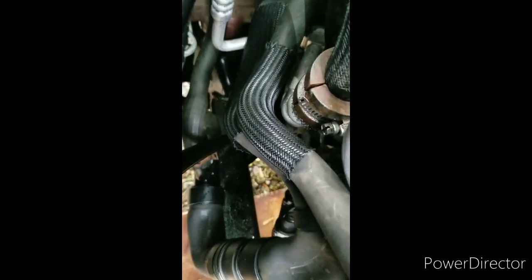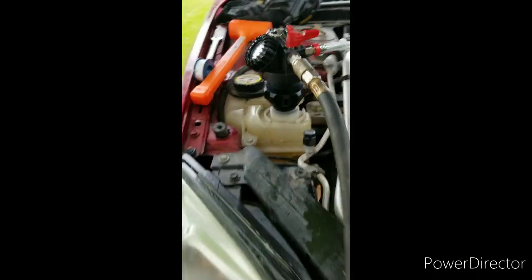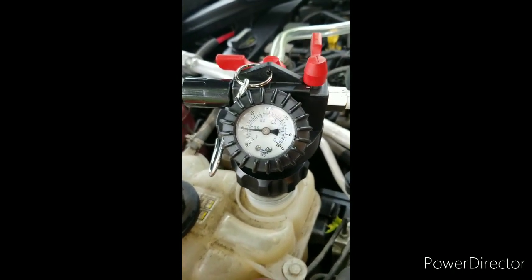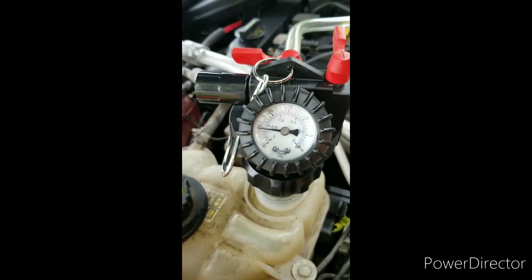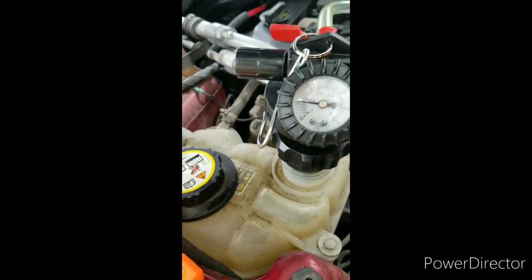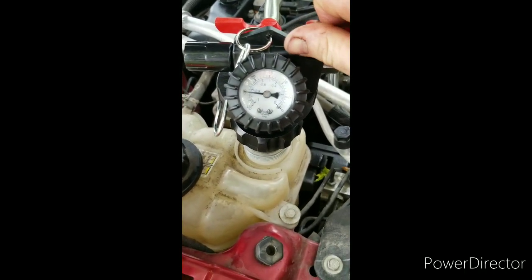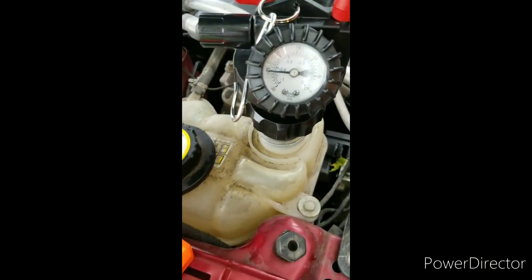The advantage is that now you look at that coolant hose — my main coolant hose right here, you can see it's collapsed, and that's the one leading directly into the radiator. So this thing's doing what it's supposed to be doing. It has pulled a vacuum on the system and it's staying at negative 25. We're going to make sure it's still pulling that vacuum. This one, which is the filler line, needs to be shut and turned all the way toward the front, and then you just turn the air on. The air blows through and carries vacuum in the system.